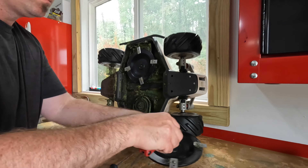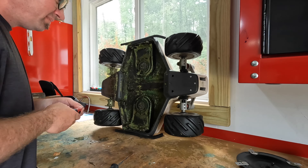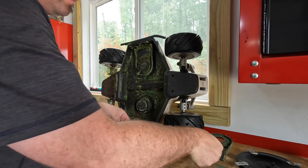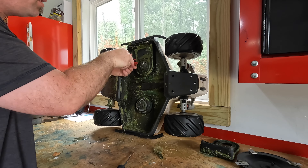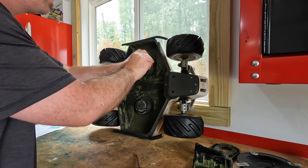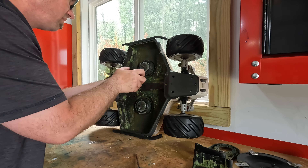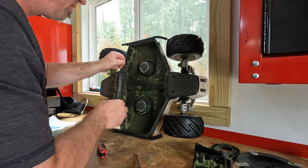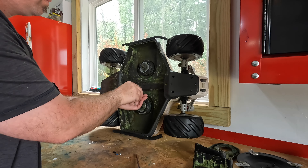Disassembly is pretty straightforward. We start by removing the cutting discs, and below them are the guard assemblies — so we take those off. Once the guards are out of place, all of the socket head cap screws that hold the black underside to the white top are exposed and you can remove all of those. They're all socket head cap screws — you can use an allen wrench, or in this case I have a multi-tool that gets at most of them. An allen key with a socket would be nice, but some of the holes are a little too deep for a standard one to fit completely.